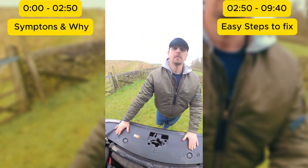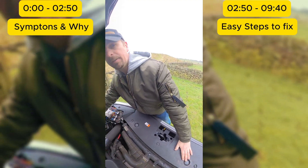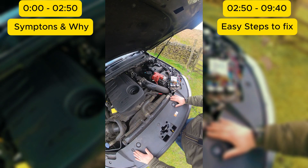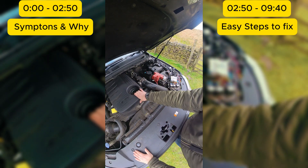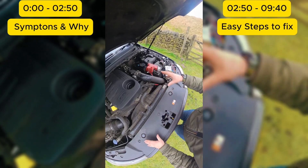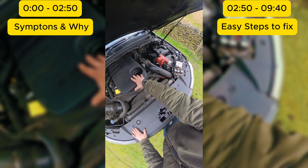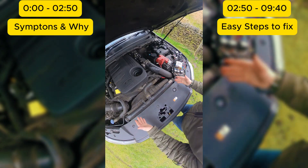You can draw air from the fuel lines connected to the fuel filter — that's the low-pressure system. Alternatively, and this is what I'll explain, you can bleed the air from the high-pressure fuel pump inlet valve. The reason to do it from the high-pressure side is that any air in the low-pressure side will end up there anyway, so you may as well save time and do it once from here.